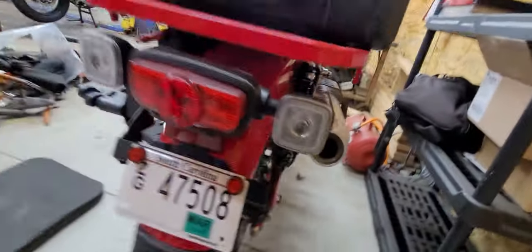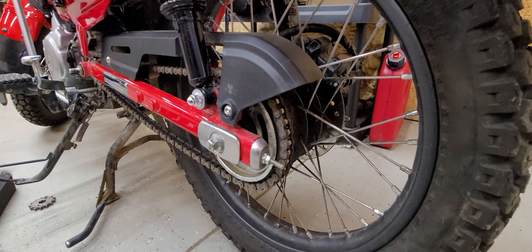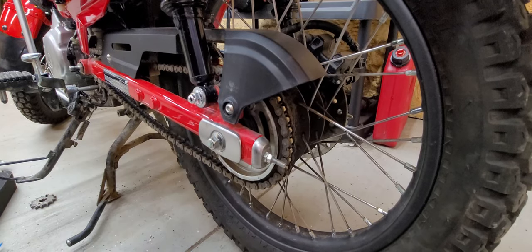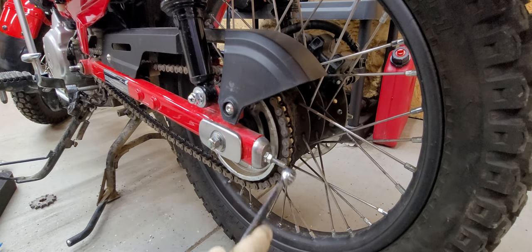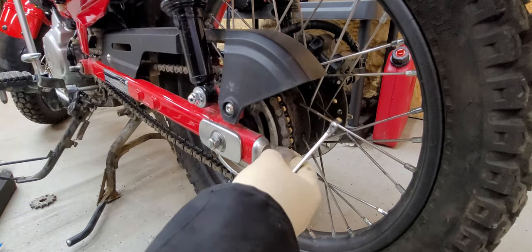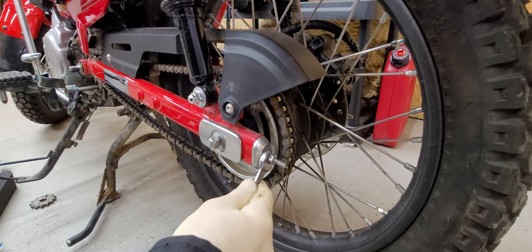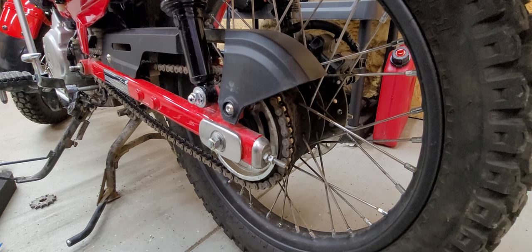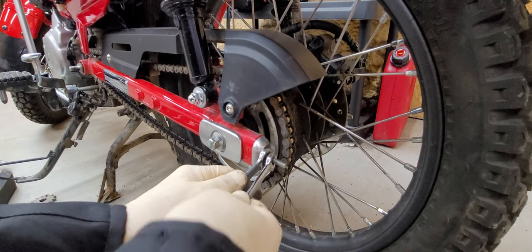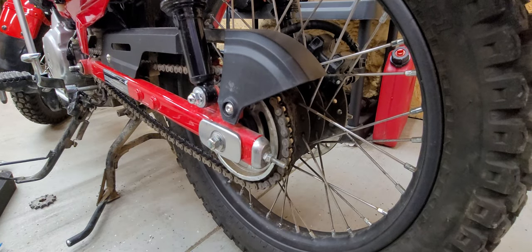Now let's do the other side. We ended up with about 4.5 marks, and we've got about 30 millimeters — I think we're good there. You'll want to let it down and just make sure once you sit on it that it's not too tight. Take the 12 and snug this against that — you know that's not going anywhere. Run that back down tight, then jam this against it, and that'll keep you from losing the adjuster nut. All there is to it.